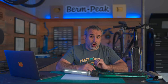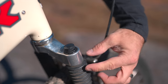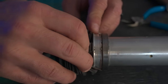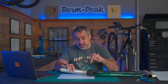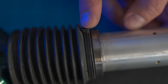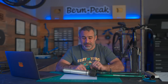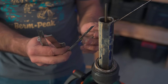Suspension forks from the nineties all had these rubber boots on them. But when you pull back one on a traditional suspension fork, you're just exposing the stanchion to some dirt. On a head shock, if you pull this boot back, it's like pulling back the Terminator's skin — all the internals are just exposed. So it was really, really important to keep this in good working order. These zip ties were actually from the factory, and if you serviced it and had to boot around, you would put another zip tie on it to make sure no dirt would get inside. Back then, if you were lax on maintenance, you would quickly find that your bearings and races would start corroding and your damper would get all gummed up in pretty short order.